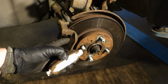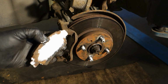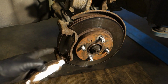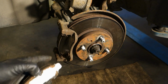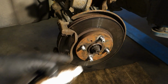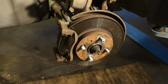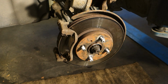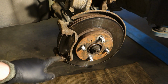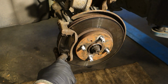And what is the benefit? If I lubricate these brake pads, then these brakes work better and there are no brake issues, because normally when brakes become old and brake parts become stuck and they are not movable, then we have a bad issue in our brake system. And that means in these areas I can insert this. And also in those areas, which are these support points where brake pads go, and it happens so that I insert grease with my finger.